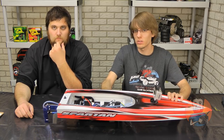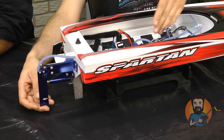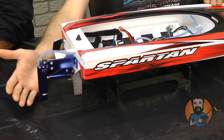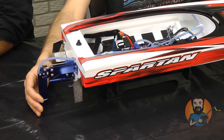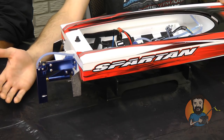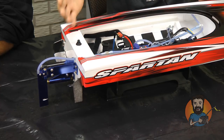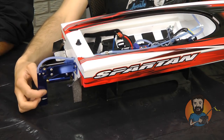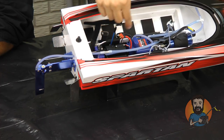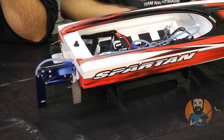If you're running 6-cell or buying a brand new boat, it's not a bad idea to do these cooling mods. The biggest problem Traxxas had with this is not the quality of the electronics in terms of overheating, but the pickup on the rudder. They're making so many of these things — tens of thousands being produced — and many had a bad pickup on the rudder. The hole is too small, so you don't get water going in. If you don't get water and you don't have airflow because the hatch is on the whole time, of course it's going to overheat. So widen up the intake hole a little bit. We also did a T-split so the intake splits between the ESC and the motor separately, then exits out the same hole. Those two mods made it run extremely cool.